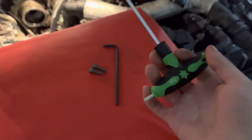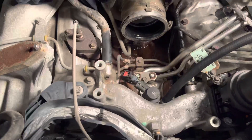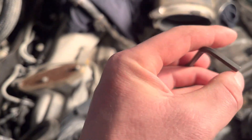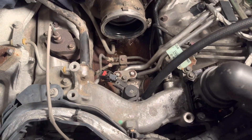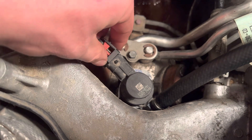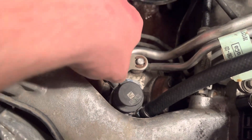I had to go out and get a special tool to get these two bolts out — and the kit gives you new ones with it, obviously, because with the new distribution block in there these wouldn't have enough room. The new ones are a normal Allen, which I wish the old ones were, because then I wouldn't have had to make that Harbor Freight run. I tightened it using my fingers on the edge, just until it was as tight as I could without going too much torque, since I'm not sure how I'd get a torque wrench in there. Now I just have to make sure I plug this FCA back in — the last thing I want is a bad connection and then having to take all this back apart.